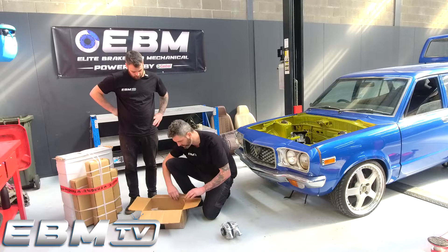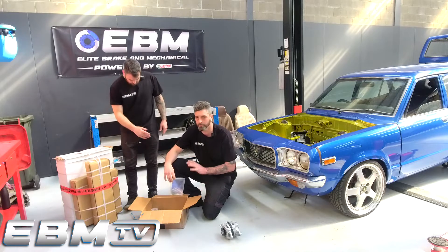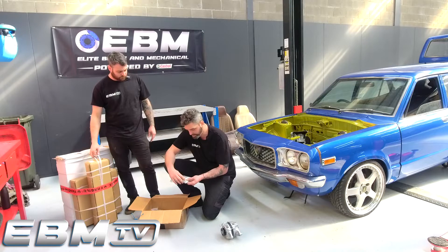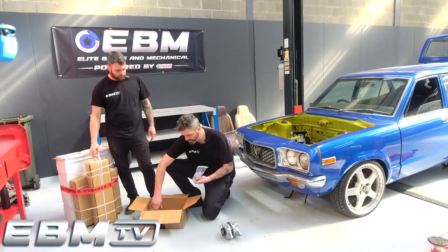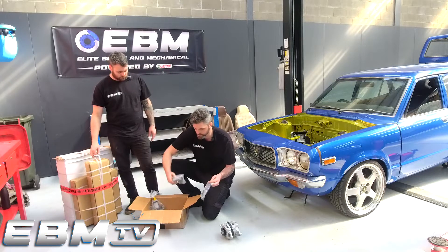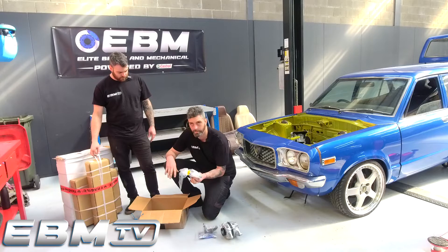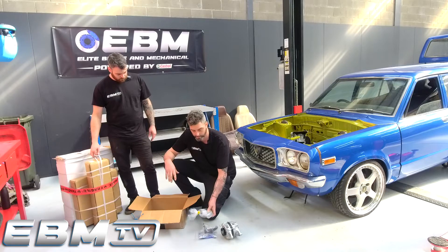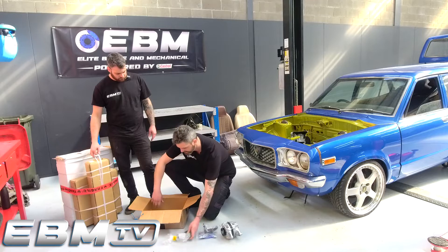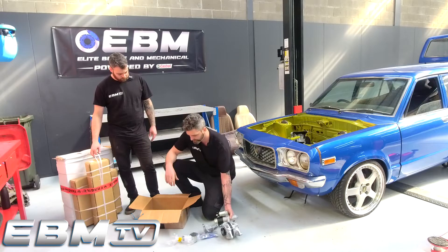The rest of the stuff we got off a guy in Sydney — he's got an eBay store called Blue Coop. Top guy, really helped me out, gave me all the information I needed when I ordered the parts. Got a plug which we'll need for the Haltech when we decide to wire in the alternator. There's also a brand new pushrod for the clutch slave cylinder, which he supplied us as well. Got a new clutch master cylinder — we will need to make the line that goes from here to there, but we want to get the rest of the engine stuff in first so we know where to route it and how long the line needs to be. New starter motor. These are all available on the eBay store, so check it out. We'll put the link in the description.